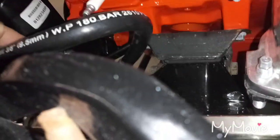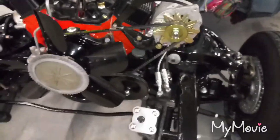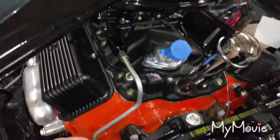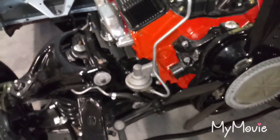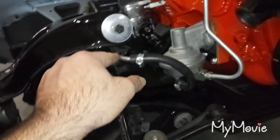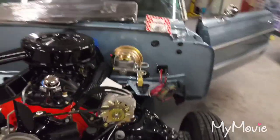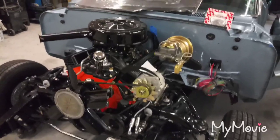One return with a hose clamp, and the pressure line screws in back to the pump. I did have to trim the return a little bit — maybe about 10 inches off. Then I got the gas line done — it's all tight now. Once the motor sat in, it freed up a little slack between the A-arm, so I was able to run the last piece of stainless gas line — I think it's the third or fourth short hose. It ties in under the frame with another rubber hose and hose clamps.